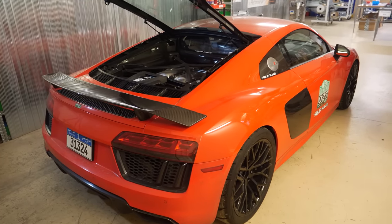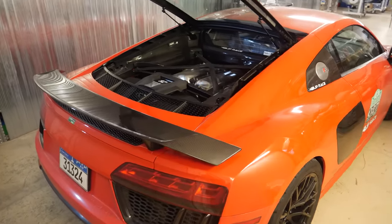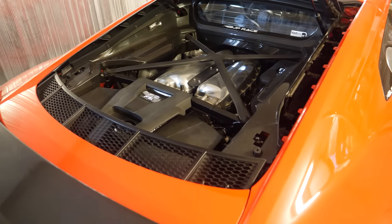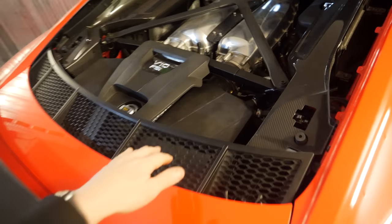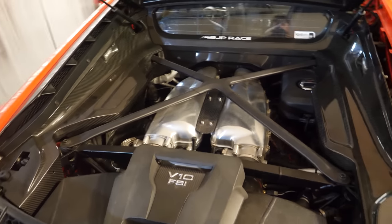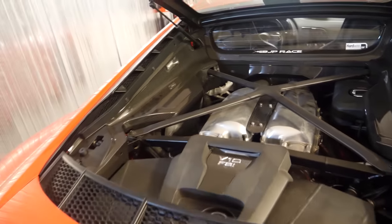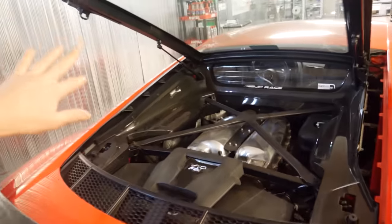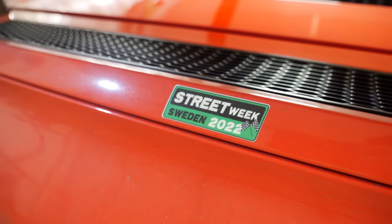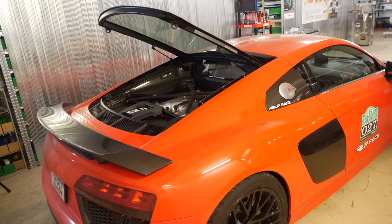Hello and welcome to a video where I'm going to talk about this car's very special intercooler system. I am cooling the intake air in this car with the air conditioning. I have built a twin turbo system on this car and the air charge is cooled by water-to-air intercoolers, but the water is cooled by an interchiller connected to the car's air conditioning system. I was driving in the street week this summer and actually won. I had really low temps on the intake air and I will show some numbers and logs about that.